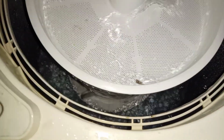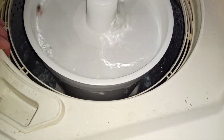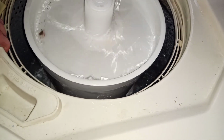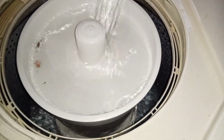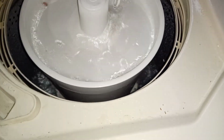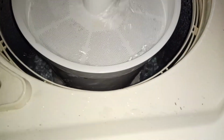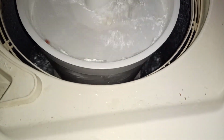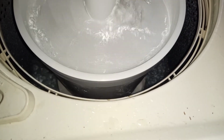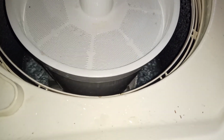Okay. It's a brand new, never used GE from the 80s, but it came from the factory with a defect in the transmission. So what happens when it's run? Or just it doesn't run? The spin bearing was never put into the transmission. Oh. And it was never filled with oil. Ooh. I don't know how it passed through somehow, but hey. I've got a source for a transmission in Cleveland, so I can manage that just fine.